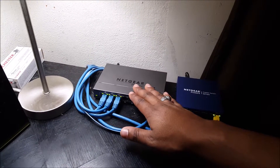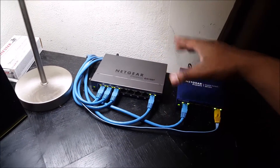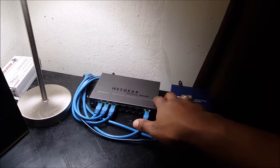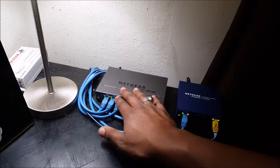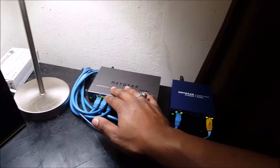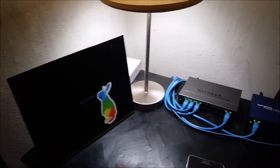So this has a few goodies on it that you would need. I will leave a link in the description below on how to set up your network and use it with these two devices. If you are using these two devices, you will definitely have to have another router. You'll run into an issue because they give you five static IP addresses, so you have to break those off into another router that can handle your DHCP clients.